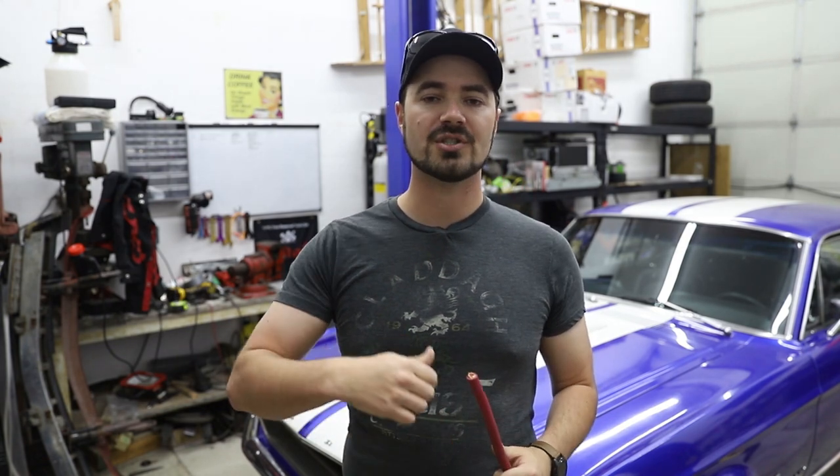So in this application I'm going to be using the real copper welding wire, both black and red. I got both colors just because I'm a little OCD about what I have to deal with going under the car. I will be running those all the way to the front. Rather than running these up from the trunk right now, I'm going to start at the front, figure out where the end point is, then I'll know where the two ends are and I can begin to run backwards to where I already have my battery placed. So let's get started under the hood of the car by taking out the battery.